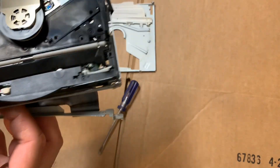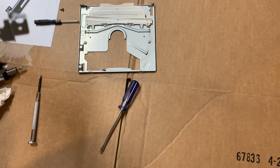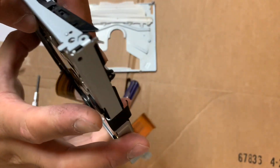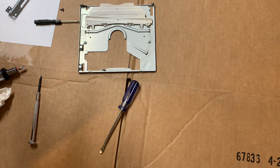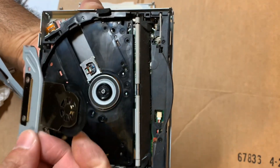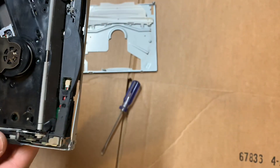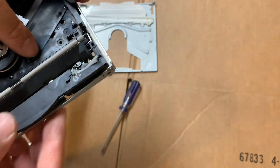During your cleaning you might have shifted the drive a little bit, so go ahead and press this drive back into the base foundation. It basically has these rubber isolators that it sits on — sometimes they come off, so just push these isolators back in. This DVD top holder sometimes slides off, so what you want to do is slide this back on — there are two pivots here. Just slide it over, put the lid back on, and you should be ready to go.